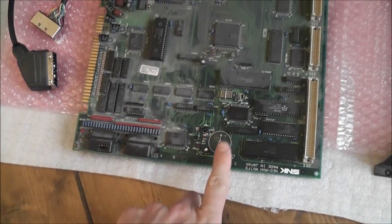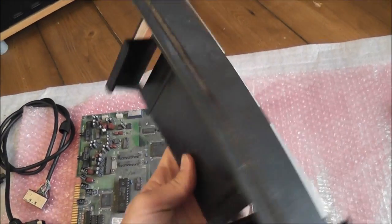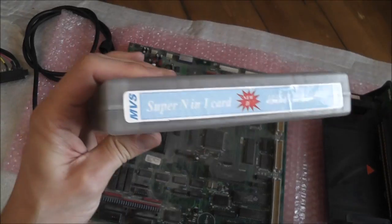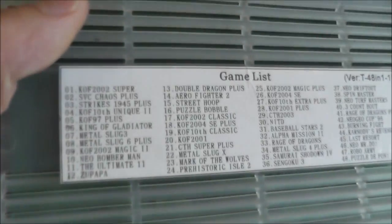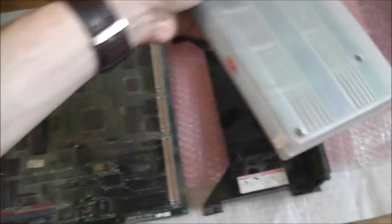I'm hopeful I'll get it running again. I'm waiting for the replacement battery holder — that's the only part I don't have yet. What I'll probably do tonight is hook up all the connectors so it's ready for when I get that sorted and get the trace reconnected. That's the top section where you plug in the cartridge. I also bought a 48-in-1 multi-cart. It was cheaper than buying a single game and since I don't have any games for this system yet, it's a good way to test out several — it's got Metal Slug and Strikers 1945 Plus among others.